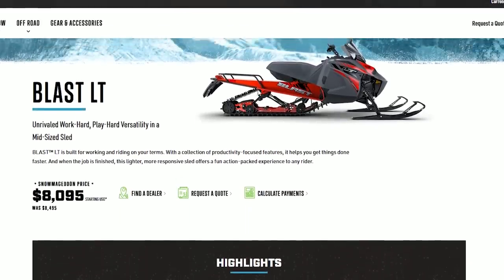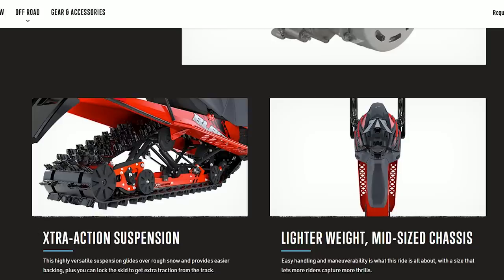Let's check out the utility LT unit. Very similar to the trail unit, but the skid is a little different - there's a little more articulation in the back of the skid, a longer track, and I think a slightly more aggressive track as well. This was something they did in the Bear Cats too - I think they stopped producing certain models altogether. This is a similar design where the back of the skid articulates. They're all the same engine, just with different tunnel extensions and skids. On this one we're down to a 1.6-inch lug, which actually still isn't bad for a utility sled.